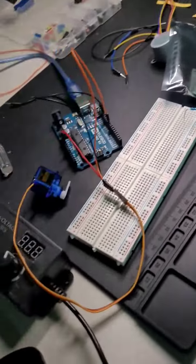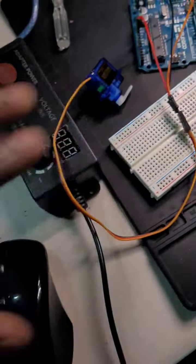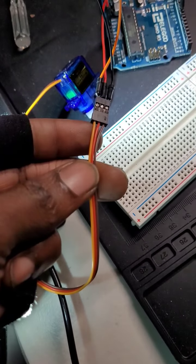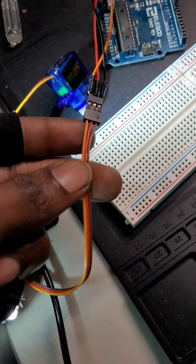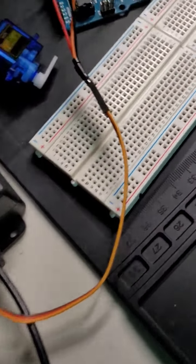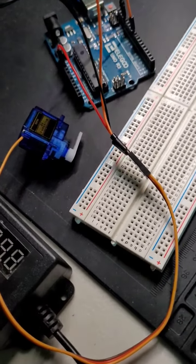So before I upload the servo code, I'm going to check the connections. Checking the diagram, it looks like we have red power, orange is signal, and of course brown is ground. Some controllers have different signals. Some have hall sensors, something telling the controller, or vice versa, what your wheel is doing when it's spinning.